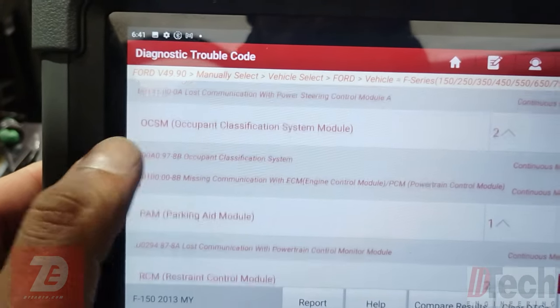I got it cleaned, plugged in, PCM plugged in — I haven't attempted anything yet. This will be the first power-up of the vehicle. Look at that — red letter P in the gear indicator, and we got mileage! Green corrosion was keeping us from communicating.